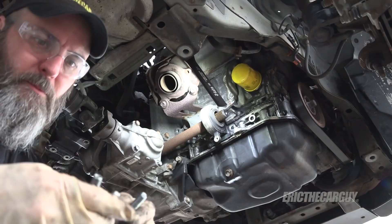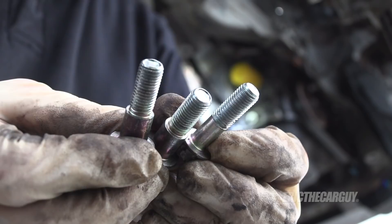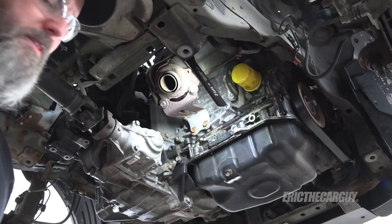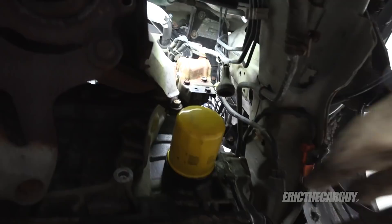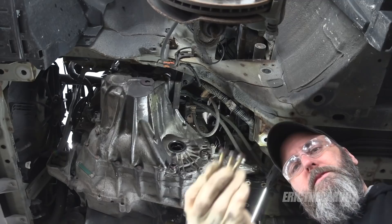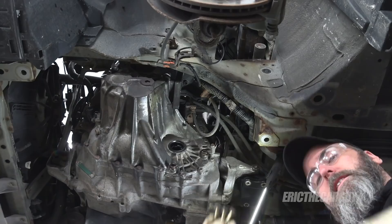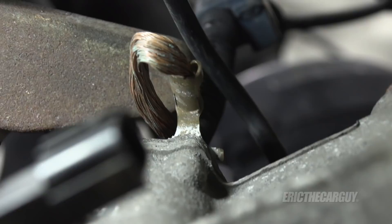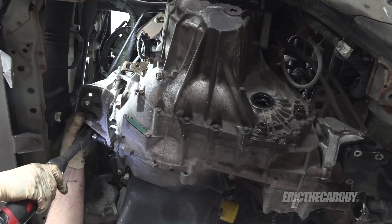With these intermediate shafts, two of the bolts have a shank on them and one does not. The two with the shanks go here and the one without goes on the lower part. With those out of the way, you just pull it out. These three bolts hold the lower air box support and they're all the same length. There's another electrical connection with the clips already broken away, which makes it easy. I'm taking all the lower supports for the transmission off so I don't have to do it while it's swinging from an engine hoist.